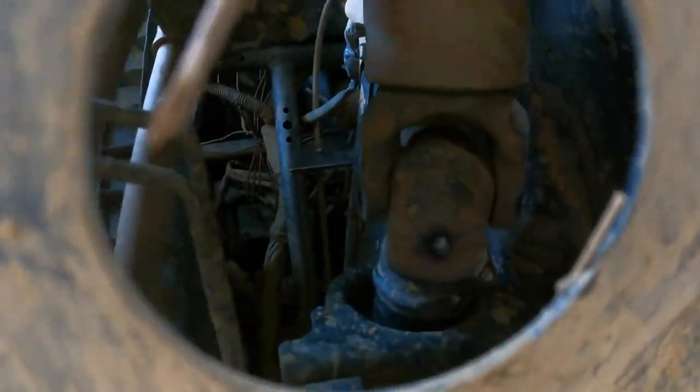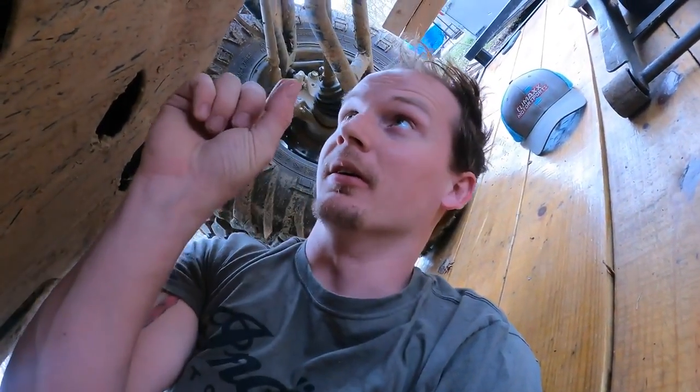You don't need much. All you need is a little spot weld to just hold that end cap from coming out of there. Pretty simple. You can easily do it with JB Weld, I think, if you just clean your area up good enough. Once I tack the other two sides, I'm going to spray a little bit of paint on there to keep it from rusting.